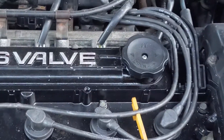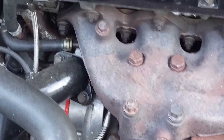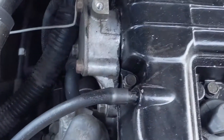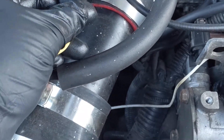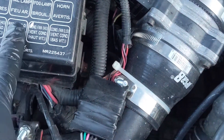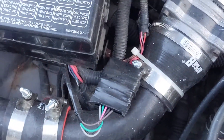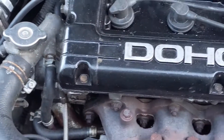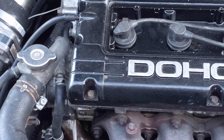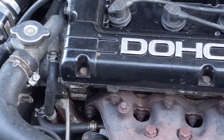Now we're filling it back up with oil. I like to put just a touch extra in because we have a fresh oil filter and there's no oil in the turbo yet. One thing I like to do before starting it up: I have an inline fuse for my fuel pump so I pull that and crank it a few times to get oil pumping through. If not, you can pull your fuel fuse and crank it a couple of times - usually about five to ten seconds, just enough to build up some oil pressure. Once you see it register on the gauge you're all right.